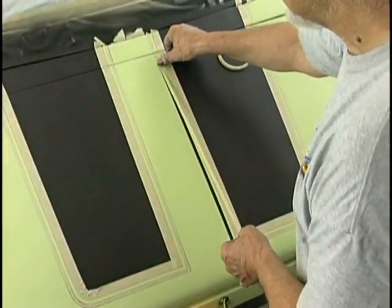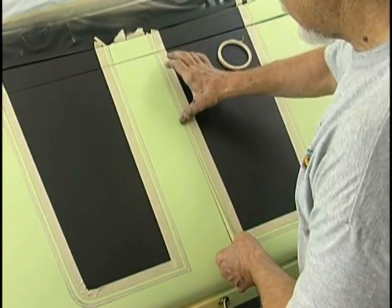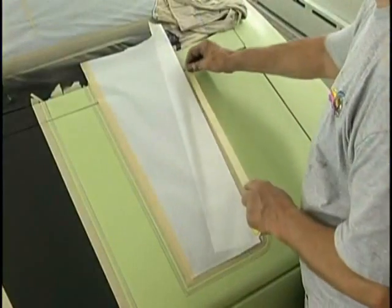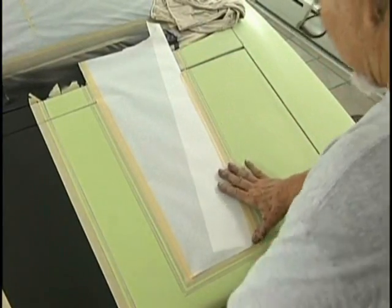We've got all the tape pulled off now, and now we have to reverse tape. In other words, everything that's got the base on it now, we're going to put tape on because we need to protect it so that we can put on our last and final base, which is the pale gold. Do you understand what we're doing here? We're butting the bases together so that there's no one base thicker than the other.